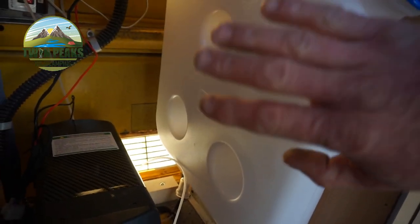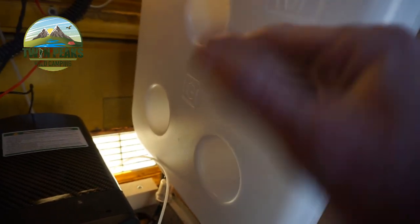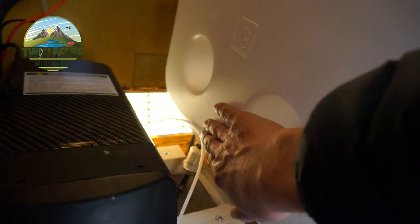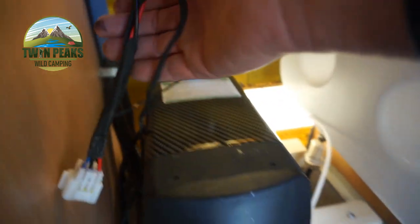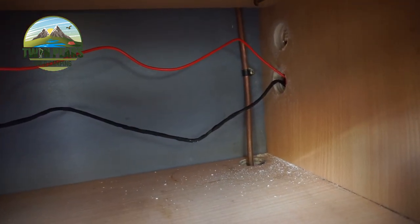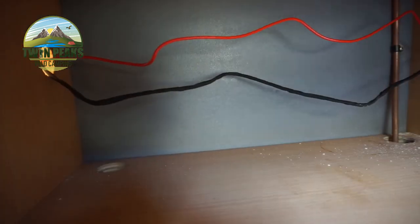Bit of a progress report now. I've bolted the fuel tank to the side panel, but what I've done is tilted it forward a bit so it's slightly out of level, so no sediment forms in the bottom of the tank and goes into the filter - if any sediment forms it'll be in this corner and won't go through the filter. Also, Karen's in the process of connecting all the cables. I've drilled a 35mm hole through both sides of the panel to put the wires through - that'll get all tidied up with cable ties.